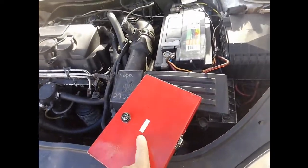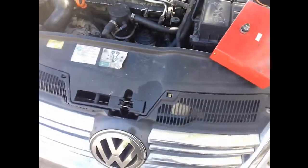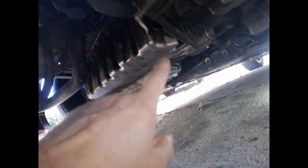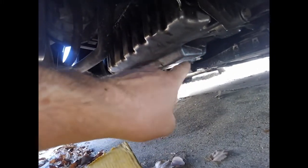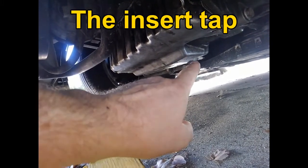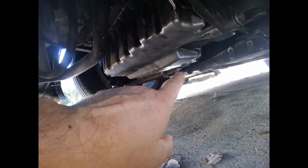So what I did was I used this set — more on that later in the video — to re-thread the oil pan. It's actually on the back of the oil pan there. The video actually showed me taking off the oil pan, but I didn't have to do that — I found out later. I thought the thread would hit on the way it was machined inside, but it would have went through. And this will apply for many vehicles as far as re-threading.